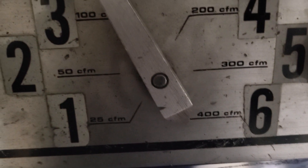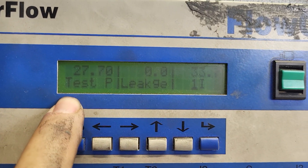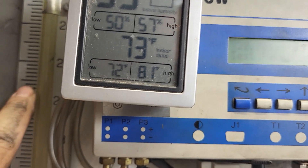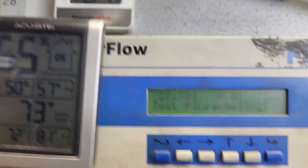Let's bring it to range six. You can see the original markings said 400 CFM. Somewhere I have the original calibration sheet for this at 25 inches — it came with all the paperwork on the bench when I bought it. You have to zero out your manometer, and when you turn on the bench and you're under depression it's got to read 28 — otherwise your calibration is off. Each range has an adjustable amount to it. Mine's at 27.7, same idea.